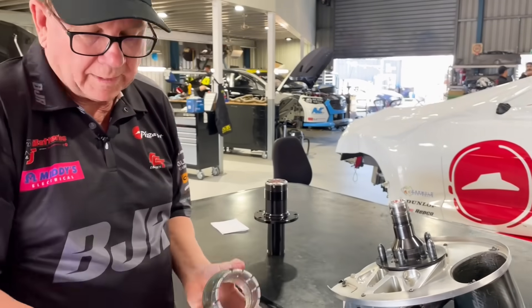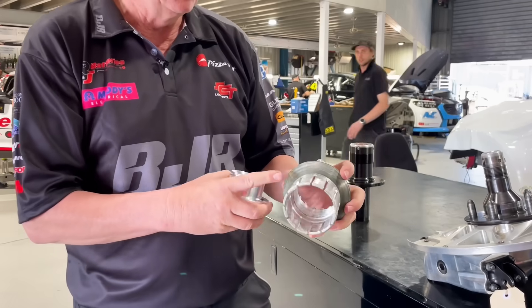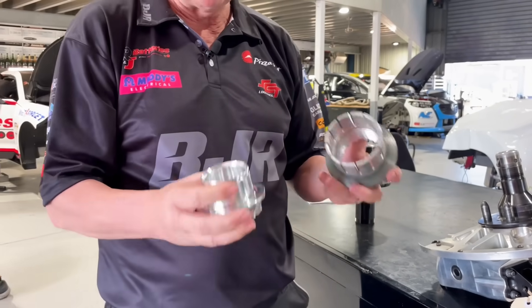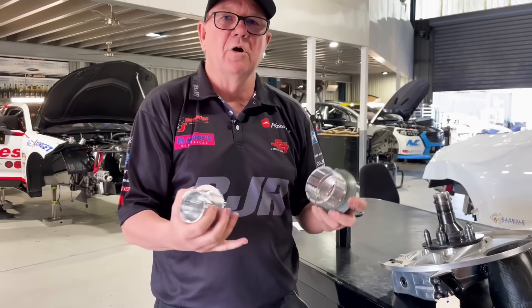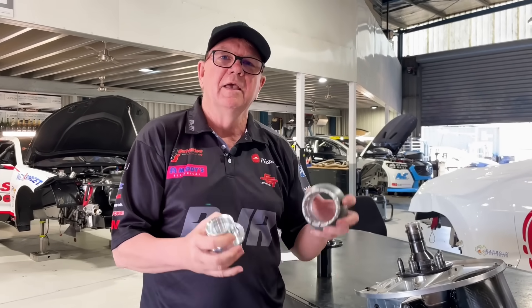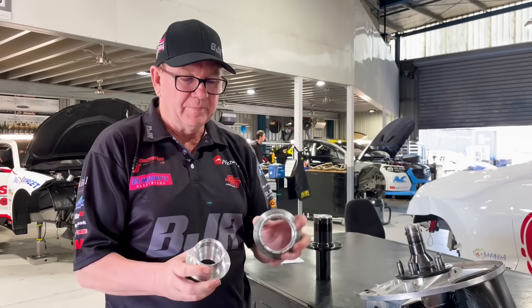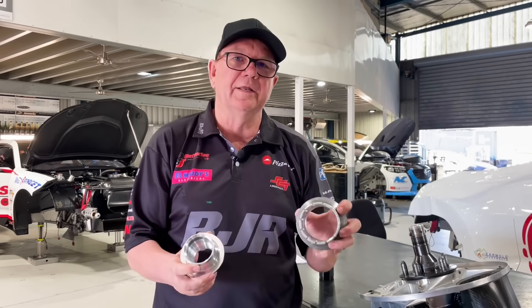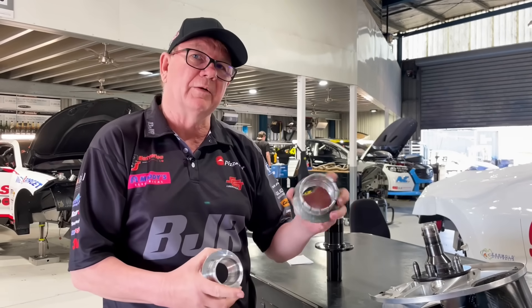You can see one's very flat on the inside, and the other one's got a taper on it. The wheels are aluminum, so it's aluminum on aluminum — they heat up at the same time. In years gone past with magnesium wheels, one would heat at a different rate and the wheels would tend to stay on. But now with aluminum, they either get wound on too tight and stick, which is why we used to treat the surface so they could unwind.